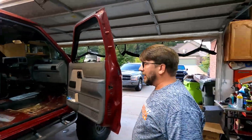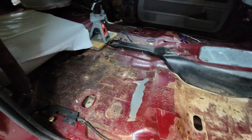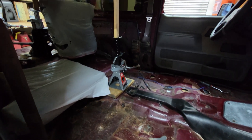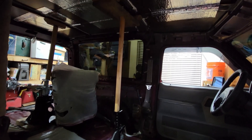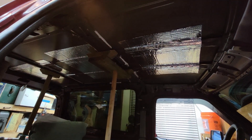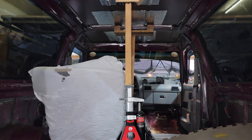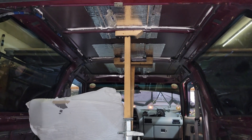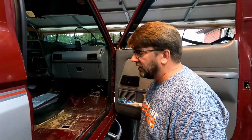We got the interior completely gutted. Right now I've got a couple of hydraulic jack stands in there to fix an oil canning issue I had in the roof. If the crossbars weren't mating with the sheet metal and going down the highway, it would oil can terribly. I'm going to be sealing the whole floor and putting sound deadening on before I put this thing back together.